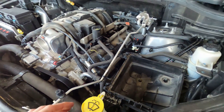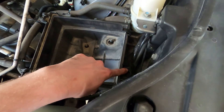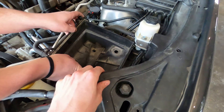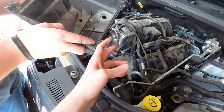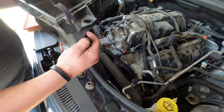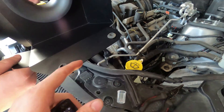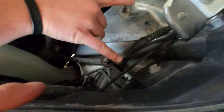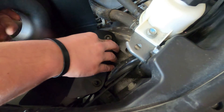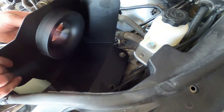Now that you have the factory intake system removed, you are left with this bottom piece. It actually has a clip here along with two or three grommets. So all you do is pull it right out. There are two external clips for the top of the intake system right here, and boom — your entire assembly is removed. Make sure you pull these grommets out of the factory air box because you're going to need those for your cold air intake. The new cold air intake system only comes with two grommet holes, so put the two grommets in and set it in on these two posts here.